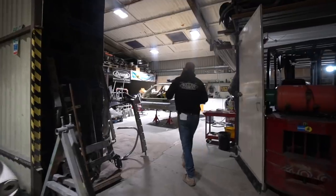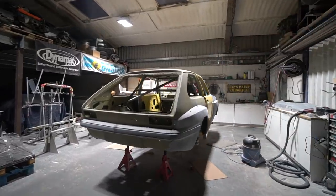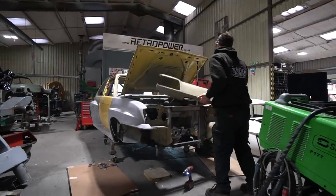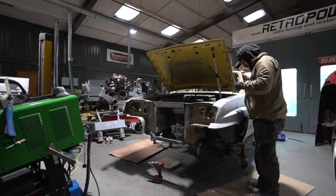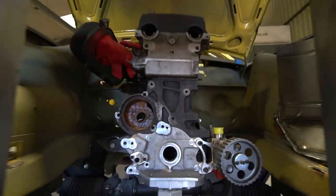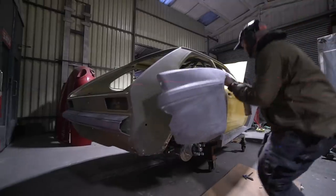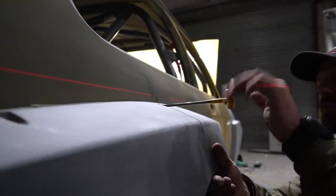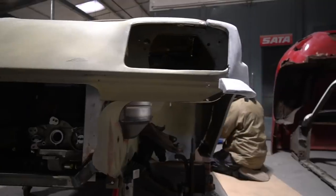The Chevette — Gaz has been working on the body kit fitment. He's made various bits of progress, doing brackets for the bumpers. We've just done some brackets for the front bumper this morning to get it lined up. Modifications to the wings are getting there — he's modifying the headlamp apertures now to get the right shape so we can fit headlamps. They won't be standard headlamps, so there's various work to do in that area. He's also doing bits of prep on the wings, fettling the mounting holes, filling flanges, and all the fun work with fibreglass to make everything fit.